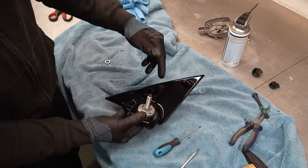This is the supply bracket, and first we can mount it to the brackets of the adaptive housing. And now we can pop this in, and we can see where we need to do the first round of grinding, because remember, this needs to move freely in there, and right now it doesn't. So I'm going to take a marker, just mark wherever I need to trim the bracket. And once I'm done trimming, we can test fit it again. So I'm going to fire up the Dremel and start trimming.